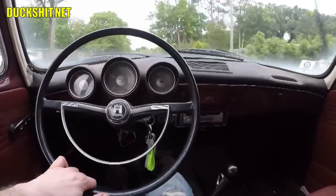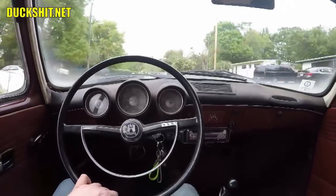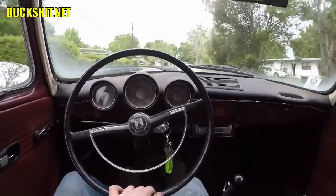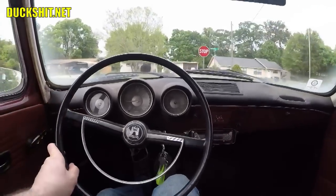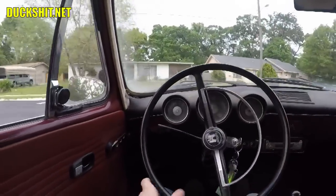And if I'm pulling up the e-brake handle, I'm not feeling the rear brakes locking up. So yeah, I probably got a little bit of brake fluid on the discs. Probably should get under there with a little bit of brake parts cleaner and some acetone and just wipe the discs down. I think they'll be fine otherwise. Just drive it for a couple days like this even, and that stuff will just burn right off.